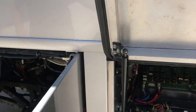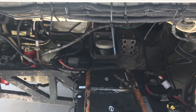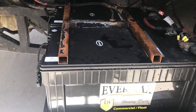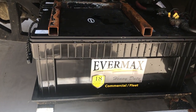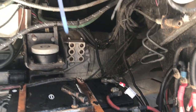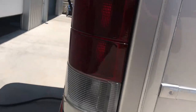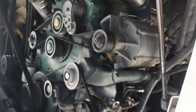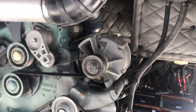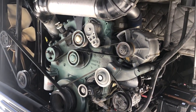There's really nice access to your engine compartment all the way around. Brand new chassis batteries — big 8D batteries. The engine itself is a Detroit Series 50 — essentially the little brother to the 60 Series. It's the 60 Series with two fewer cylinders. The injectors are the same, the computer is the same, it starts the same, it sounds the same.